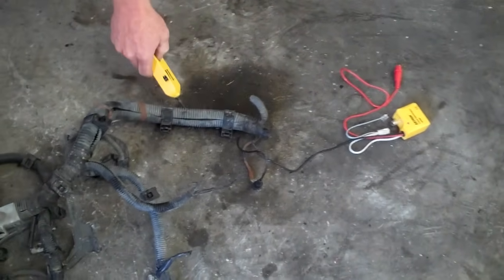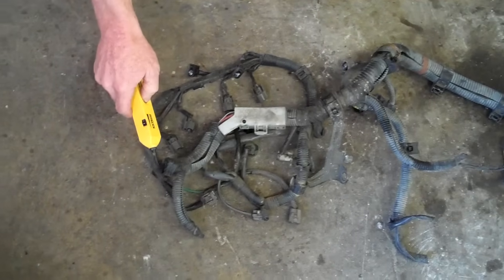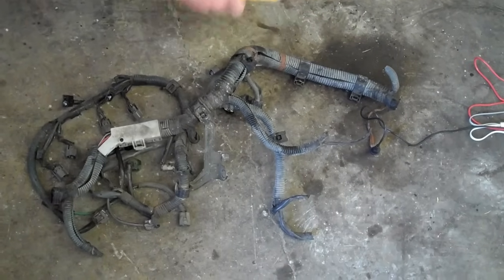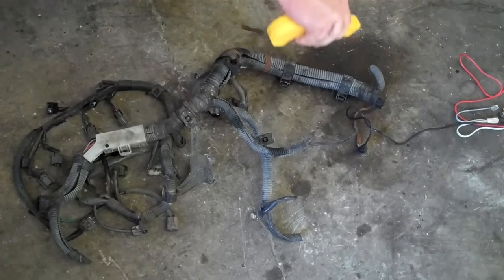So here's the way that the wire goes. I'm following the harness and I just lost tone — it's getting quieter. This is an interesting one because it's four ground wires, so it goes all through the whole harness. But any time you get close to it, you can trace to see where your short is. Otherwise, what you'd have to do is probe the wire, which can be bad because as you probe it you have to penetrate the jacket on the wire, leaving it susceptible to corrosion. This way it's very non-invasive — way faster because you don't have to do all the probing and you don't have to open the wire loom in order to check the wires.